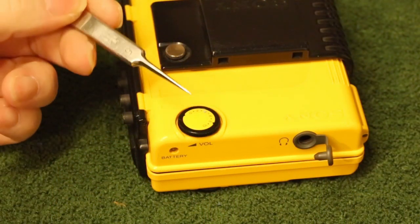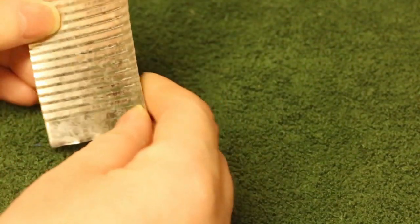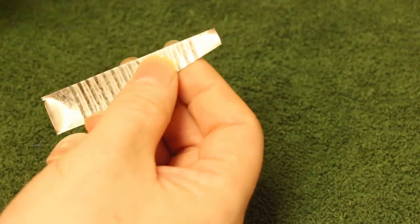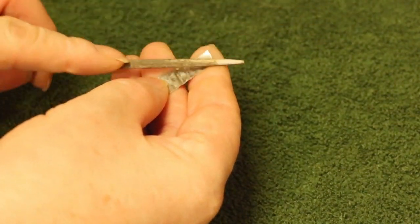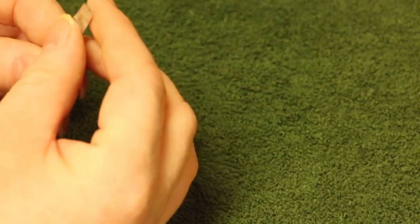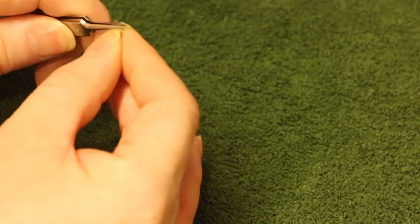The next step involves removing the volume control knob and the cover. Normally during repair this would be discarded and replaced with a new one. However, since that is no longer possible, I'm going to have to make a tool to remove it without damaging either part. A quick and dirty tool that anyone should be able to make would be one made out of an old baked bean tin or similar. Be careful as everything here is now very sharp, and about to be made even sharper with a file. Just file away the edge so that it will slip easily between the two layers of the volume control knob and the cover, bending to shape with tweezers. Then prise gently up, hoping not to scratch or damage either piece.